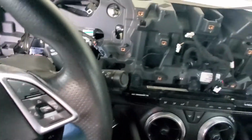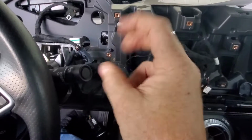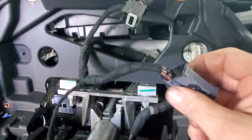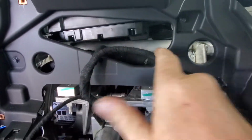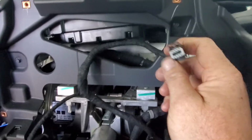It's very clean. You can see what I did. I'm not knocking anybody else the way they did it. Those little blue clips, I can't think what they call them, but these things never work. I mean, they're just horrible. But basically everything's soldered, everything's taped like the factory wires. You see this one here, what I did was I ran my pin 21 to the harness, and that's all wired into here, so when it plugs into the heads-up display, that's done.